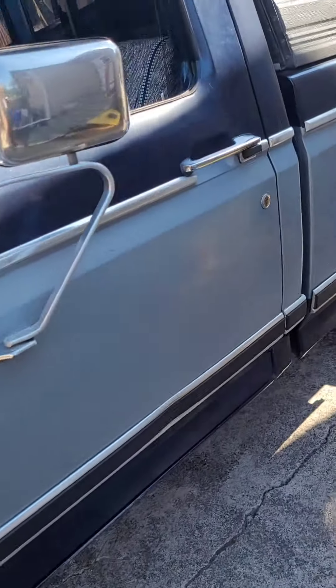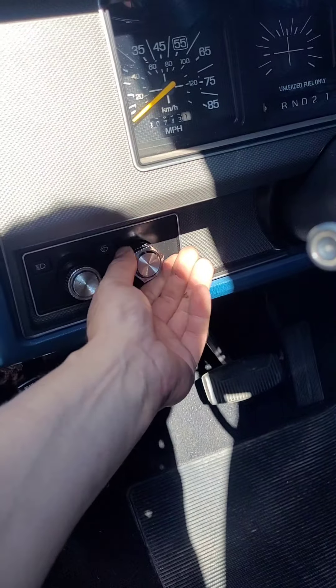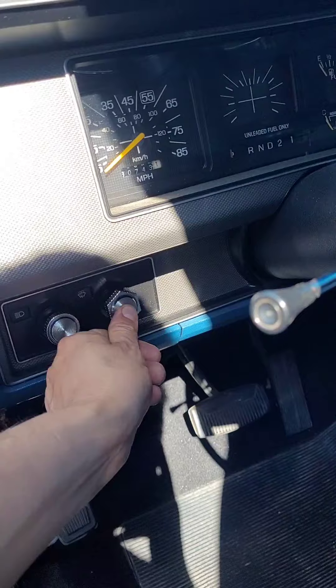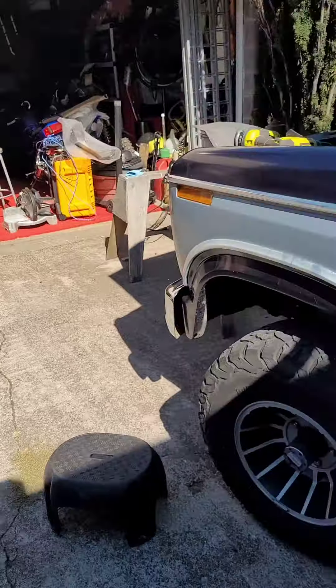So while I was doing that, I was using the windshield wipers and using the button to test voltage. This is a situation where if you twist this knob, it activates from fast to faster — that's it. Off, fast, faster. But then if you press it, that's when the windshield washer fluid is supposed to spurt out. And then once I did that, the windshield wipers would not stop. So when I put it in the off position — it very well could be the switch — but I had been experiencing some issues with the windshield wipers not stopping while driving, and when they would come down, they would not hit all the way.